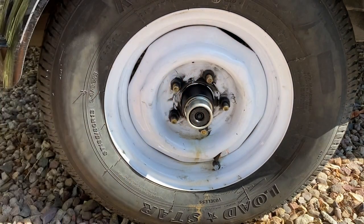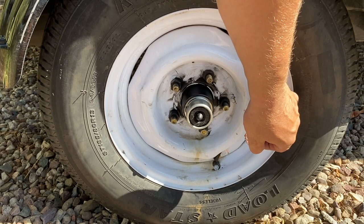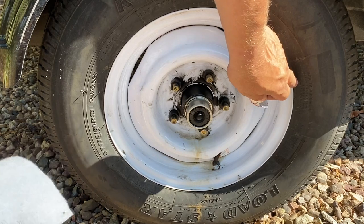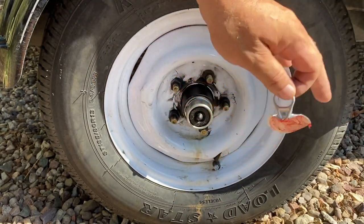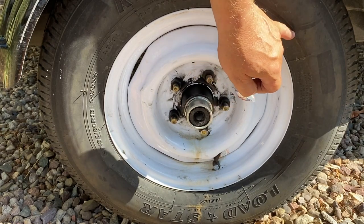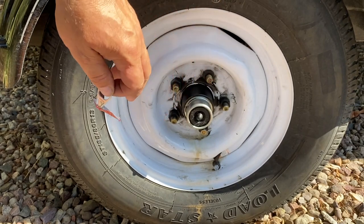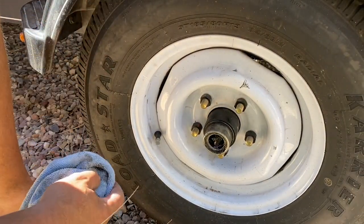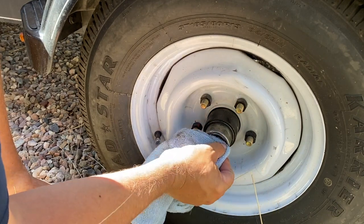I go ahead and put the new seal on — it fits a lot neater. It's called a Dexter Easy Lube, size 3185-1, and it's a perfect fit. You can find these on Amazon all day long and I recommend them. For tire pressure: the sidewall says max 50 PSI, but I keep mine between 42 and 45. The trailer bounces a lot less that way. Anyone who's ever four-wheeled knows about pressure and terrain. Going 75 miles an hour, tires will inflate a little, so I wouldn't worry — 42 to 45 is a much smoother ride.